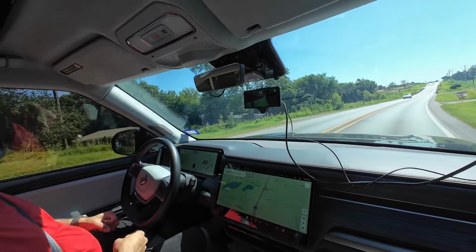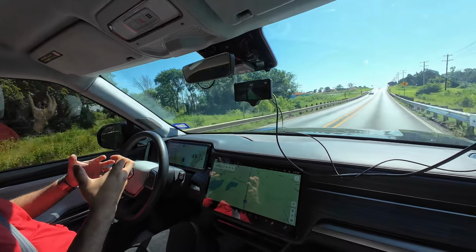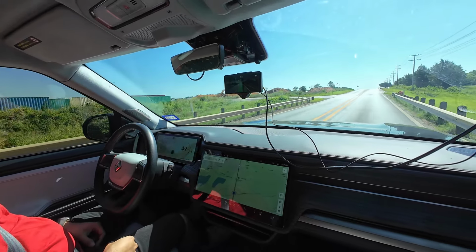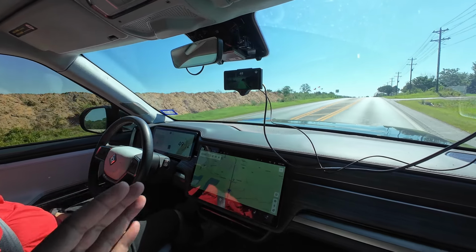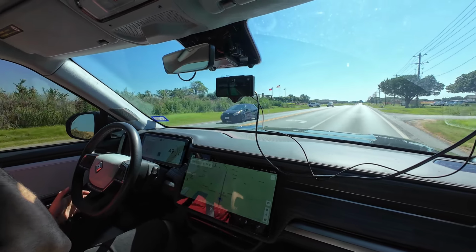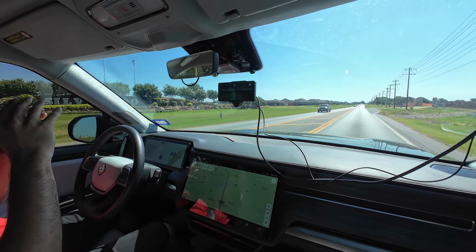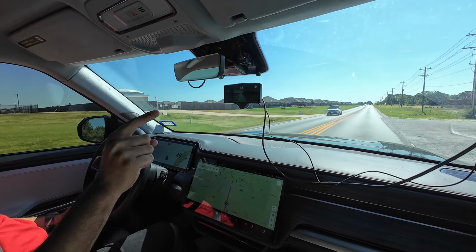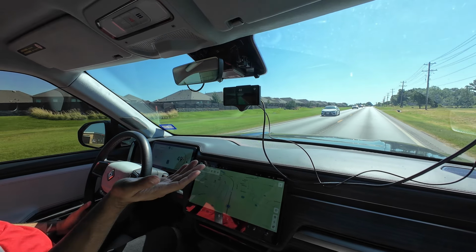And what is that when we say the torque steering, different tires? Is it different tires just don't grip as well? Or they have too much grip, so it takes more force to turn the steering wheel. Grip. Yeah. And Pirellis are super soft, and from what I understand, it's also the sidewall. The stiffer the sidewall, the less it flexes. Yeah, the more it flexes, the harder it is to steer. So LT would be pretty good because those are the light truck type and have stiffer sidewalls. Yeah, so that's what I was looking at next, Toyo LTs. These are Toyo SLs. Ah, gotcha. Okay. But I was like, if I'm happy with these, then I would consider Toyo LTs.